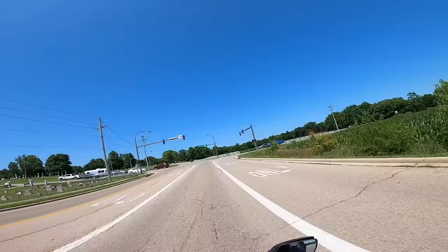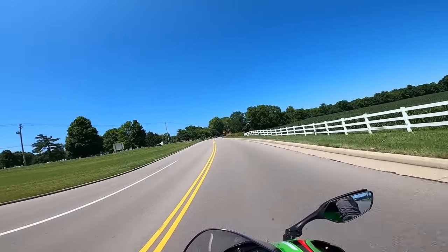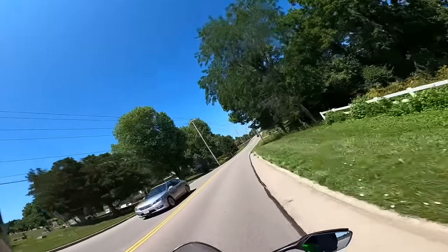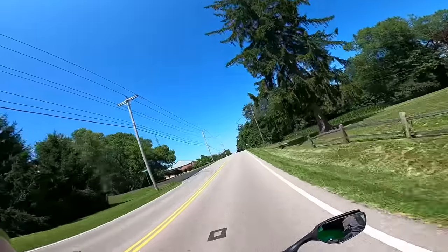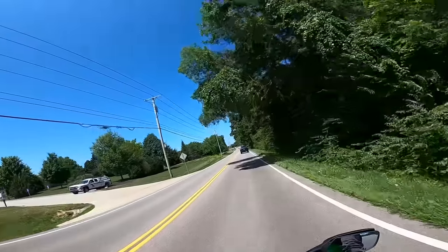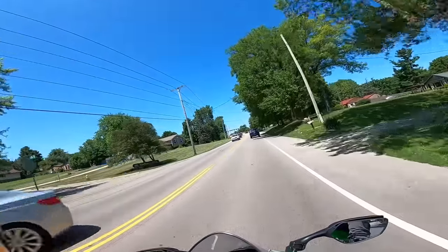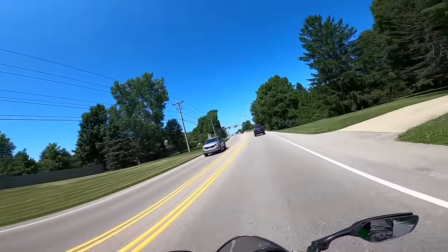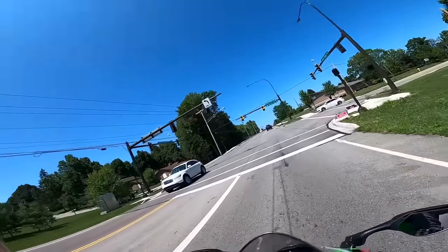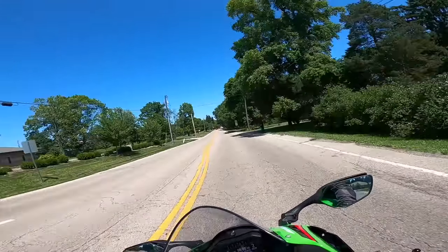Oh my God, there's just nothing like a fast sport bike. And this thing, especially since the last bike I was on was that Gen 1 Hayabusa, which is a tank, this thing just effortlessly moves around. I felt the front end getting light. I gotta tell you, I'm not a big fan of the speed sensitive steering dampers. They're great in a parking lot, but if you're like me, and you like holding on to a motorcycle that's going 100 and God knows whatever miles an hour, they can get a little twitchy. So we will be replacing the damper on this with a new Batubo, a regular manual.